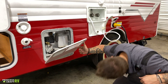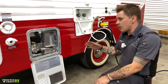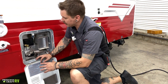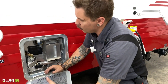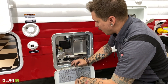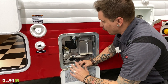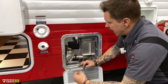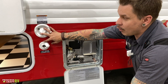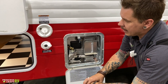There's a six-gallon capacity water heater here. The manufacturer recommends two very specific things. Number one, if the water heater is going to be in storage for more than seven days, it is very important that we drain it separately from the rest of the system. They also recommend that when returning the unit to service, we prime it — pump six gallons of water into the unit before using it. When draining it, it's very important from a safety standpoint to follow the correct procedure: give it ample time to cool down, at least two or three hours. Once confident of the temperature, cut the inflow of water — if on city water, turn off that fixture at the valve; if on fresh water, turn off the onboard water pump.